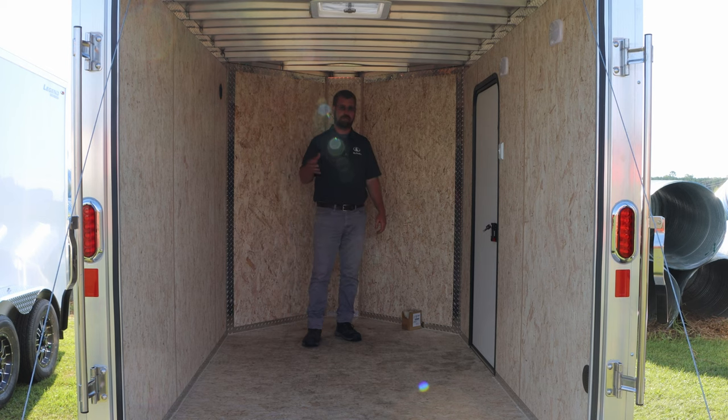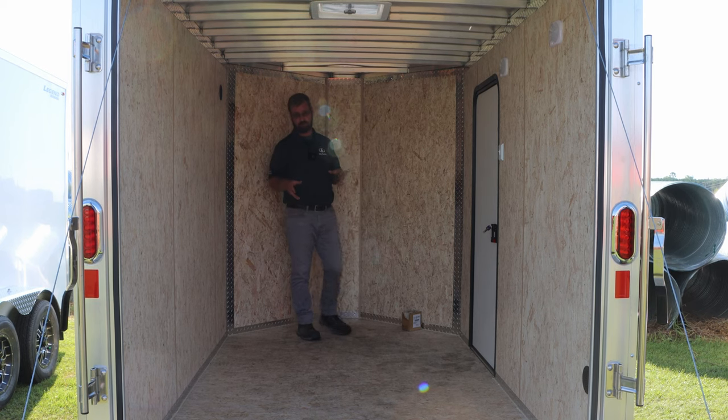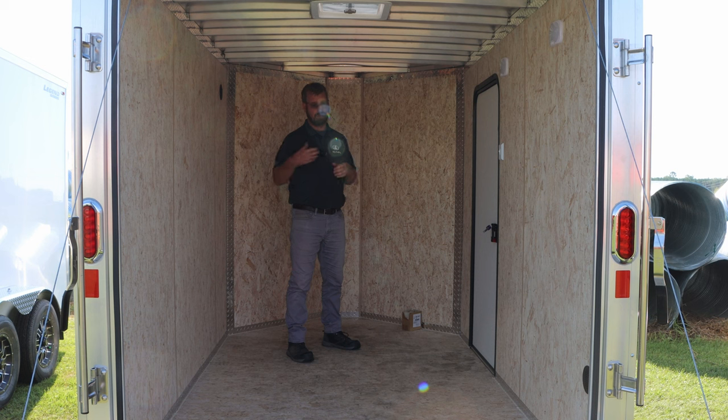Moving to the inside of the trailer, let's talk about the fit and finish. They look great on the outside and just as nice on the inside. They have 3/8-inch wood wall and 3/4-inch engineered flooring. Both are engineered wood, so that's going to prevent soaking in water and rotting. It's actually 30 layers — whenever you chip away a layer, there's another one there to protect it. I've run snowmobiles in mine — you don't see the carbides dig in. If you spin studs it will rip up the floor, but carbides themselves stay on top. The water, when it thaws, stays on top.